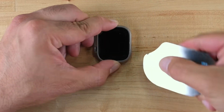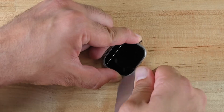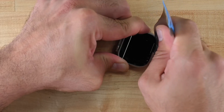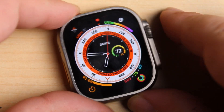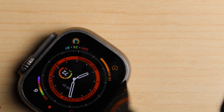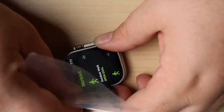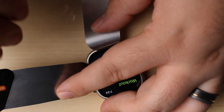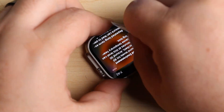The combo of flat glass and squared-off corners means I can't get under the glass even with this thin metal tool. And the screen broke — this miserable screen removal process is bad news for anyone who cracks their display. The prying angle definitely makes it easy to separate the layers of the OLED. After seeing how easy it was to damage, my goal is obviously to remove the display without damaging it. I spent the next half hour doing everything I could to get the screen to come up undamaged, and boy was it tricky. But in the last minute I figured it out — now I can get a screen off an Apple Watch Ultra in under a minute without damaging the display. If this video gets to a thousand likes, I'm going to show in detail how I do that.